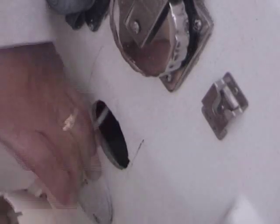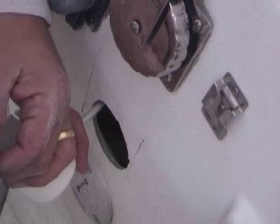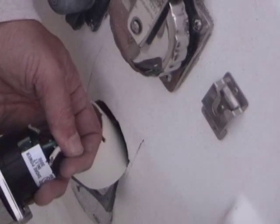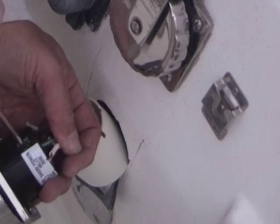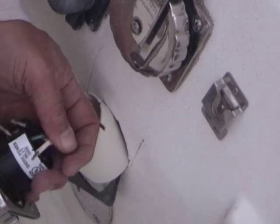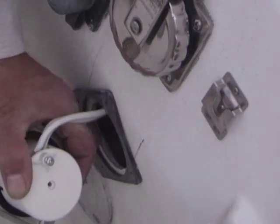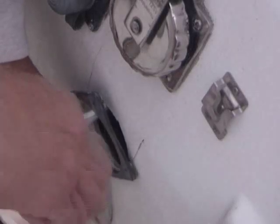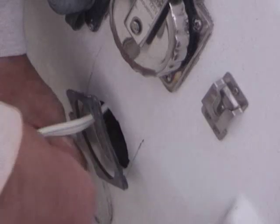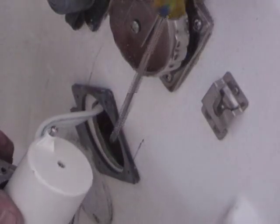I should have left a little more wire — I had a little bit of trouble there — but it's simple to do. Green to green, black to black, white to white. Tighten these up nicely, but don't over-tighten, and don't solder the ends of these either. A lot of people try to do that thinking they're doing something right — they're not. Then I attached the safety casing; there's a screw in the center, tighten that down, get it nice and snug. It helps provide a waterproof or water-resistant seal. The cable itself has a little clamp to help hold the cable in place in case something gets yanked around down in the compartment.